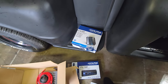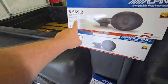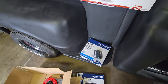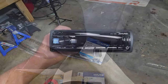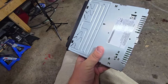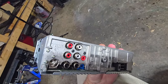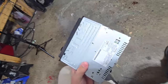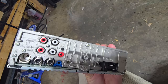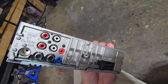It's all four ohms. I can do two ohms, but at four ohms I'll have to do 55 watts. The Alpine head unit is only 18 watts per channel, so the amp will definitely increase the volume and enjoyment of the stereo system. It has all the outputs I need to hook up to the amp and future subwoofer amp and speakers.